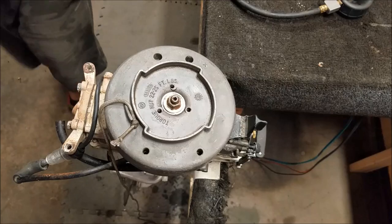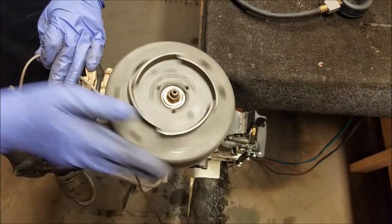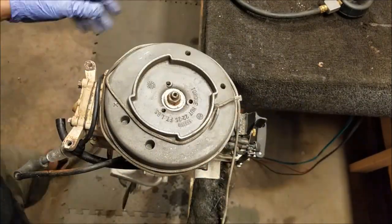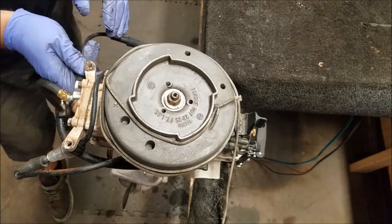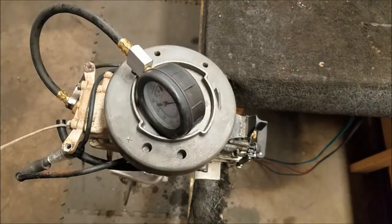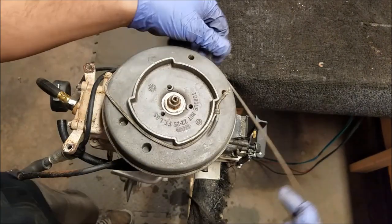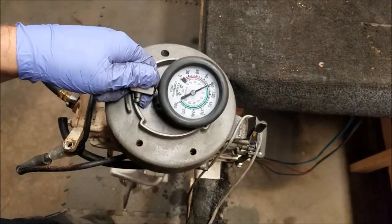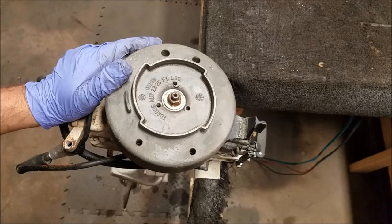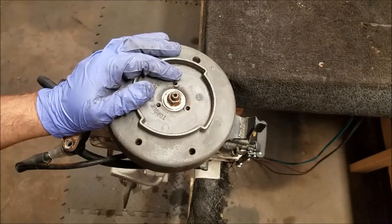We know our coil's working, so that's handy. Let me show you a trick — spray some lubricant into the cylinder, rotate it around a little to get it all in there, and then try your compression again. Two pulls and we're now at the same spot, and we are pretty much at 120 PSI. You'll sometimes see people listing higher compression results for their engine — I always think they oiled up the cylinders first.